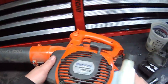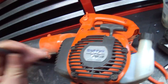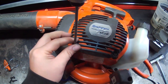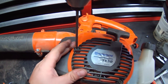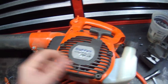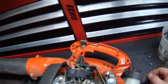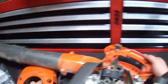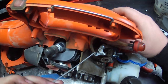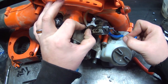I was doing that a lot more gently than it looks in the video, just to pop the seal on the top of the shroud. These are T25 Torx bits — self-tappers that go into the crankcase itself. The shroud just pops right off, just like that. This procedure is also the same if you're changing the ignition coil, which you can see right there. Then just slide that off and fish it out of the throttle rod. You've got the primer line right here.